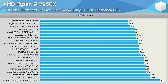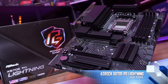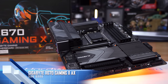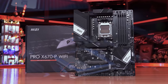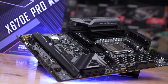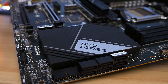For those spending $300 or less on an X670 board, there are over half a dozen options. The cheapest is the ASRock X670E PG Lightning, which is also an X670 Extreme motherboard. The ASRock X670E PG Lightning and Gigabyte X670 Gaming X are in my opinion the best options. MSI's Pro X670-P WiFi is also decent but doesn't justify its price premium over the Gaming X. The MSI board is also priced to compete with ASRock's X670E Pro RS, which offers PCIe 5.0 to the primary PCIe slot and primary M.2 slot, along with a pre-installed I/O shield and an upgradable M.2 WiFi 6E module. The MSI board has a better VRM on paper but in reality just one degree Celsius separated them with the 7950X.